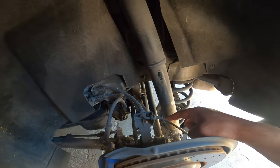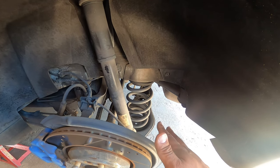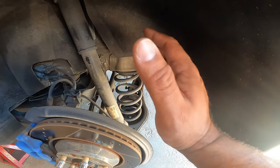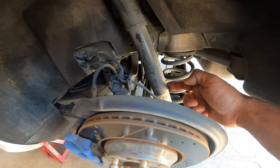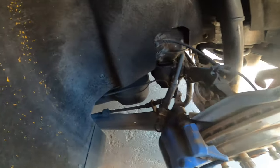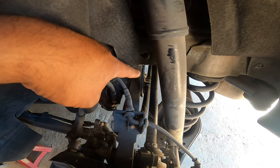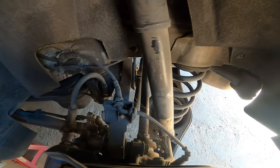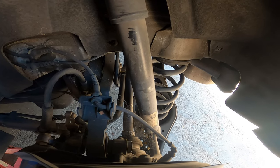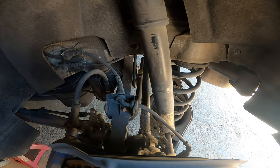So now you're going to see there's an axle there. You have your shock and a spring separate — it's not a MacPherson setup. That makes it a little different and a little bit easier because all you've got to do is unbolt a couple of things and you're ready to go. What makes the rear harder to get done is this lower sway bar that kind of prevents you from moving things. You'll see it right there at the bottom. That sway bar keeps tension on the rear suspension. We're going to see if we can do the suspension without removing it, but we might have to unbolt it — we'll get there when we get there.